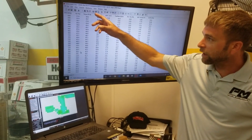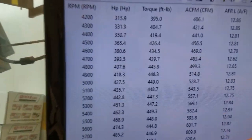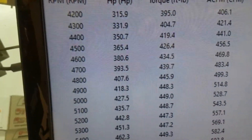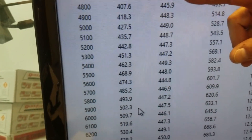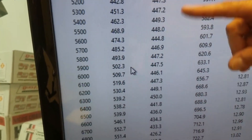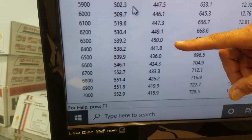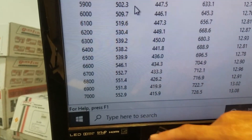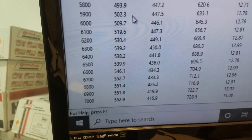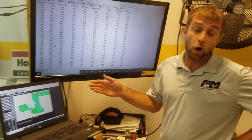Down at 4200 RPM it's 395. Anybody that's in the know, that's not super strong down low, but as you climb up in RPM where that manifold really likes to run, it really flattens out. We peak torque way up at 6300, but it is very flat from 4500 on up, and then you see peak horsepower at 7000 at 552. Pretty strong increase from an AS-CAST 185 head to our 205 CNC.